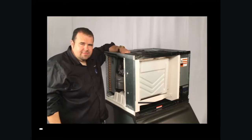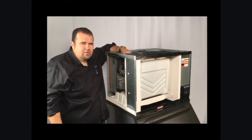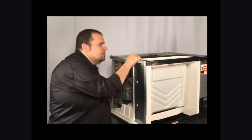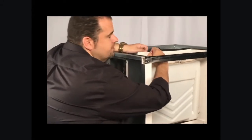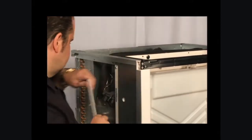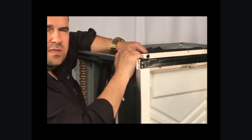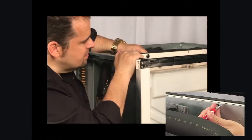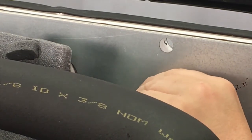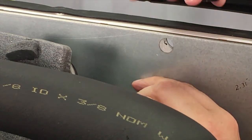With the panels off, the next step is removing the dust cover and the covers to access the vents for the Luminize Kit. We're going to move the top black rubber cover off the unit, and then remove the top evaporator extrusion cover — this can be discarded because a new one comes in the kit. Then we're going to remove the covers for the tubes that go in the machine. We poke them out from the back; sometimes they might fall into the machine. We'll pop the lower one out too — on this one it will fall down into the water trough underneath, and then you can retrieve it from the water trough. It can be discarded.